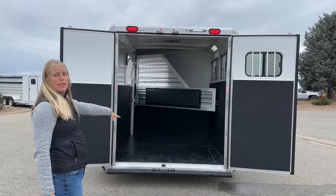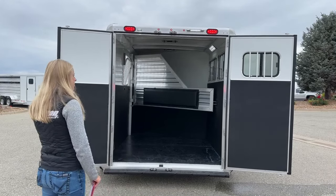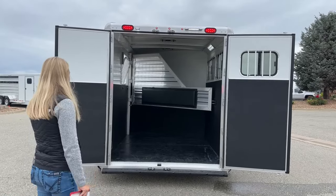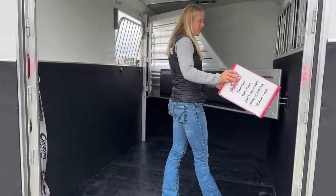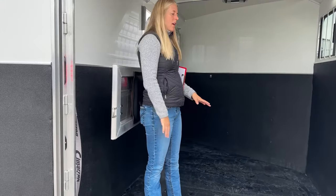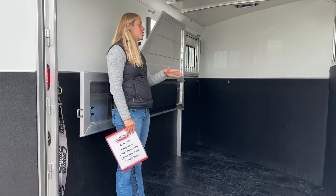You've got a nice 8-inch awning light here so horses loading at night can step right up. We did a 60/40 door split on this one — so if you've got really well-broke horses, you can just keep one door closed and walk them in and out of this 60 portion. That's why we angled the 8-inch awning light over on this side, because this is the majority of where you're going to be loading those horses. For stall dimensions, you've got a 39-inch stall on the first one, and then a 46-inch on the hip side. One of the reasons we do that is so that when you clip your divider over — it's spring-loaded — it holds itself back, so you can completely open this divider and if you ever had to run with it open, you're able to close those doors without the divider sticking out. By adding a little bit of length, it gives us the ability to keep it nice and flush against the wall.